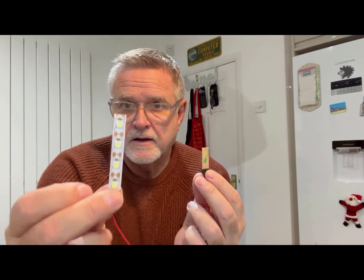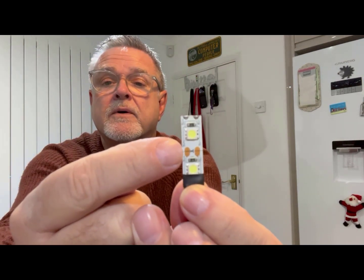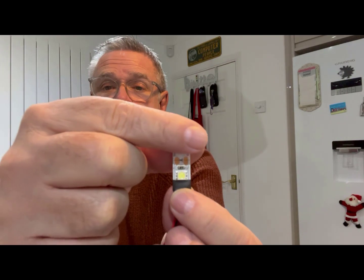You're then left with the choice of using two sorts of LEDs. I'm going to explain the difference between them and then show you the different effects. You've got the original tiny micro ones that I used in some of the trucks that I fitted a light in. Or you can use these ones which come on little self-adhesive strips. They come in longer strips with four - I think you can also get them with six or two. In fact, what I do in the store I'm going to show you in a moment, I've cut this in half. If I hold this close you will see there's a little line along there where the copper joint is - you can cut through that and just have a strip with one light.